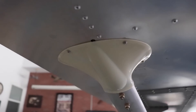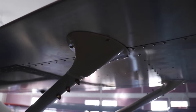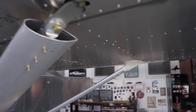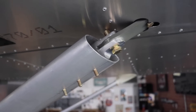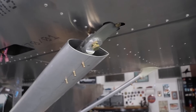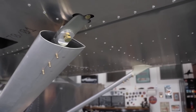One of the other things I decided to do was put the mounting screws in the fairings. These are in place and done — nothing major, nothing super fun, but now the holes are set and they're mounted. I have the aft one done on the left side, but I haven't installed the one on the forward strut yet because I'd have to remove the strut to get that bolt out. So I'll wait until I'm ready to remove the wings, and when I disconnect that strut I'll put the fairing on, get it screwed to the wing, and they'll all be finished.